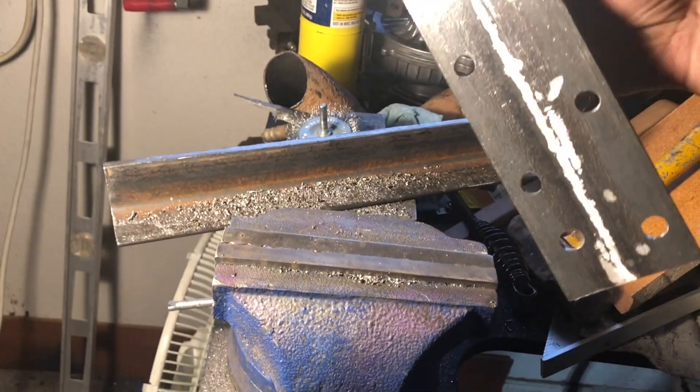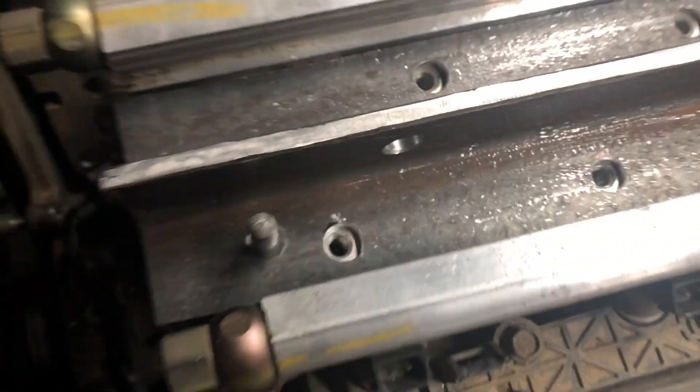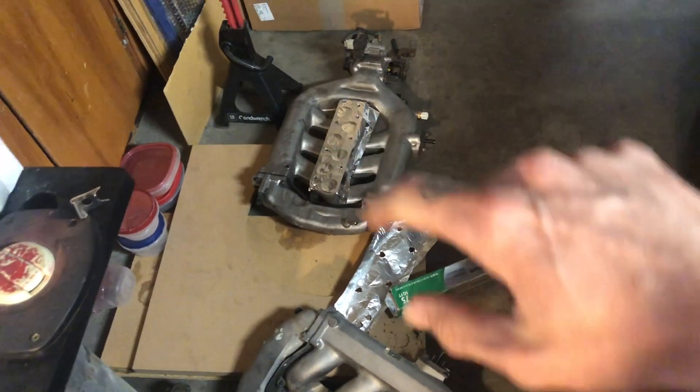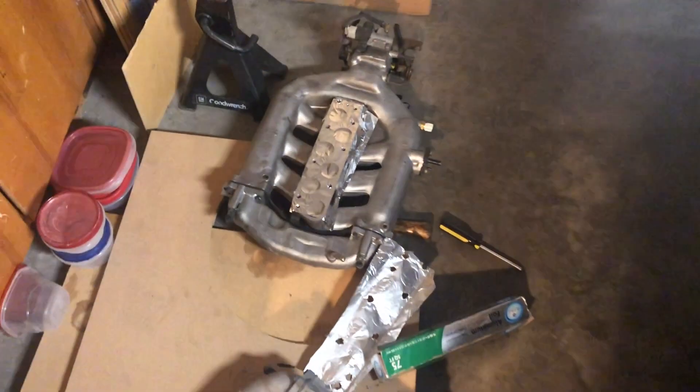So now when I take it off I can just lay it on top. This here is actually ready to paint - I've got everything all nice and flattened out, we got our holes. This gets bolted and that's it. I do have some paint for it. It got squared up on the sides because it's going to be just a little bit wider than the actual J-series manifold piece. So I just ground the sides down, one pass and another pass, until it slowly starts to come together and becomes the right width. Then I'll put that over the sides and mark it out with a permanent marker, and then drill the holes.